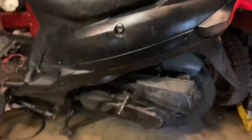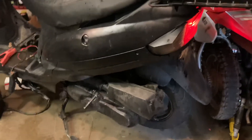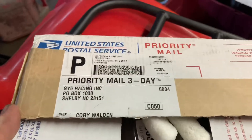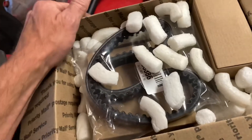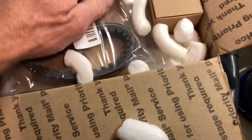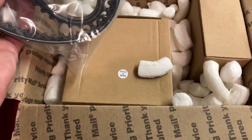First off, I don't think there's a belt in there because the tire didn't move. He said when there was a belt in there it was having a little bit of issues, so we went ahead and ordered from GY6 Racing Incorporated — we got a new belt for a short case, hopefully it's a short case. Now that I look at it I might have got the wrong belt. We also got a variator and a clutch.